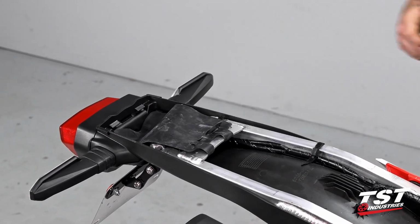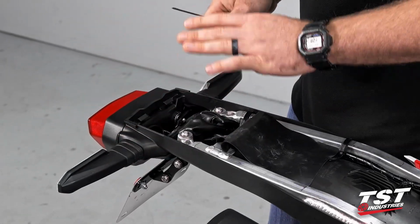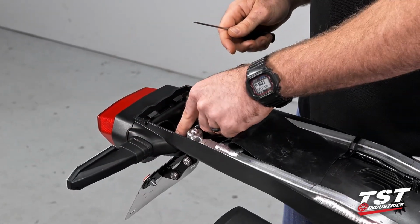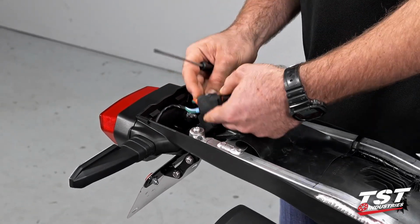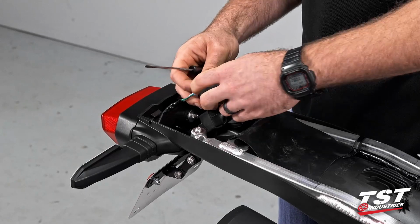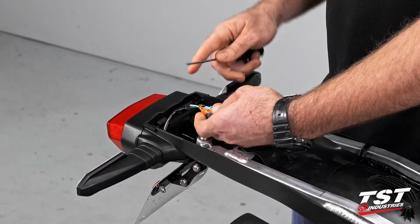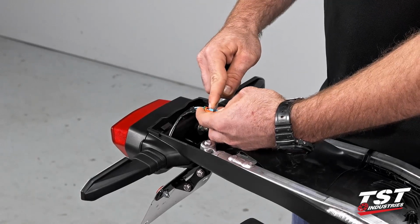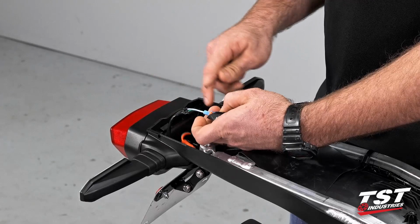At this point, while we're in this region, we're going to go ahead and take off our signals and our connectors. So we'll start with the connectors. Take these little housing boots off of where they slide onto. Expose the plug and its locking features. Just lift up on those locks with a little flathead. As you lift up, just pull the connector out.